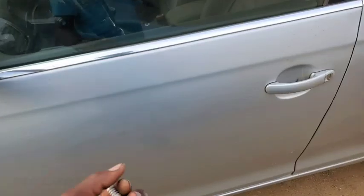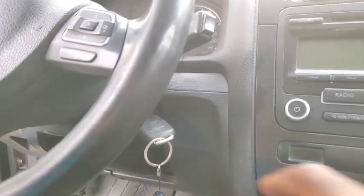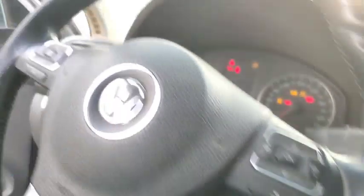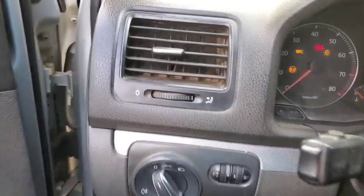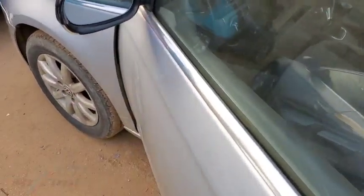The first thing I'm going to do is open the car and pop the hood open. Then what we're going to do next is turn on the ignition — get the right key for it and turn on the ignition. You should see warning lights on the dashboard. Then we're going to go over to the engine bay and look for the crankshaft position sensor wherever it's hidden.